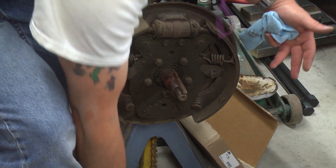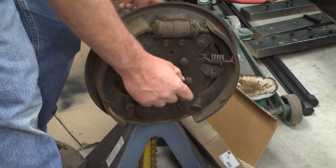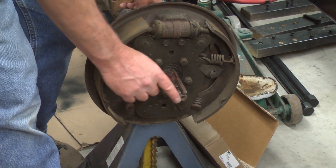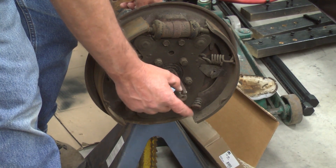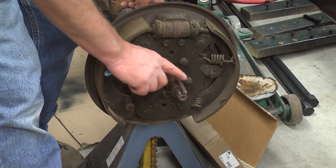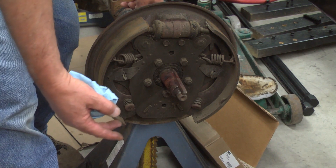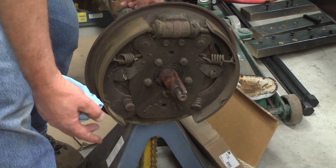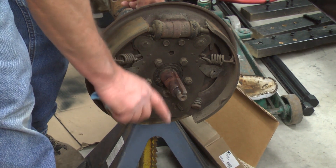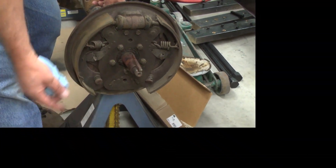There's no damage to the wheel studs. We used great caution not to put excessive force — despite the fact that it takes considerable force to remove the hub and drum, we applied the minimal amount. The sharp tap on the end of the stem relieved a lot of that tension. The brakes are now accessible. Notice the rust — one of the reasons for the difficulty in removing the hub and drum is the buildup of rust.